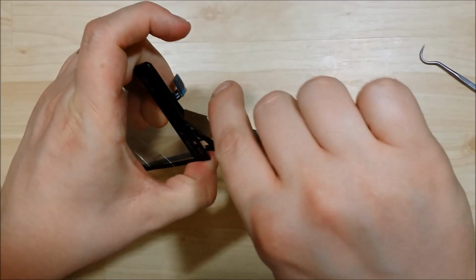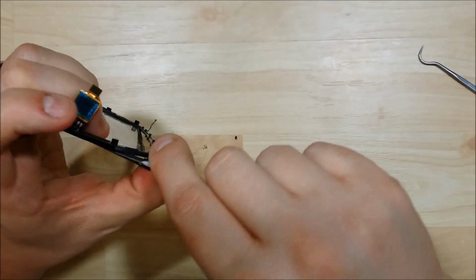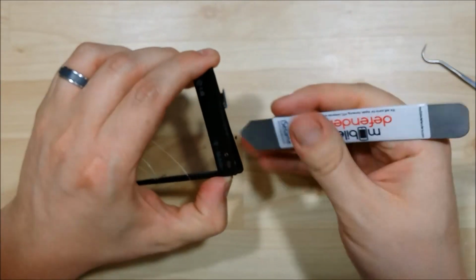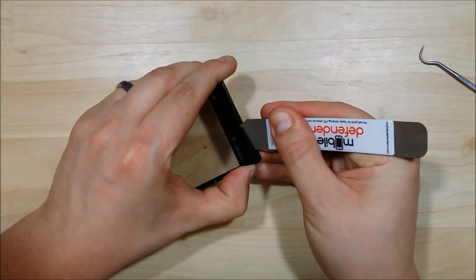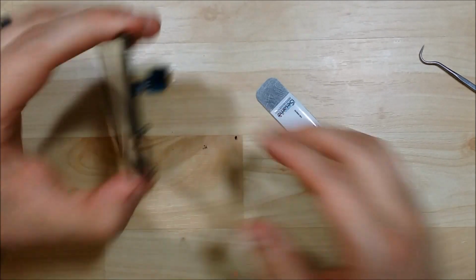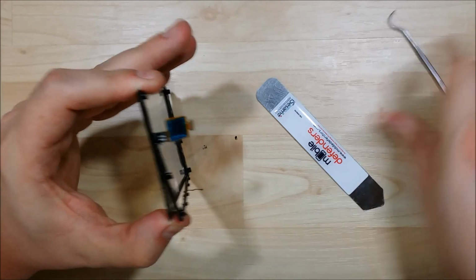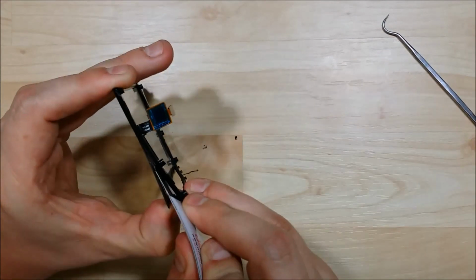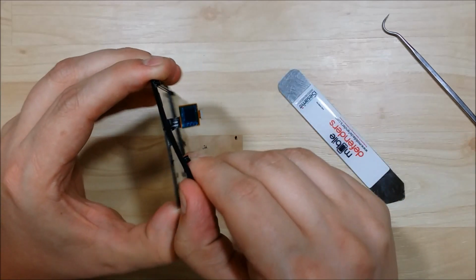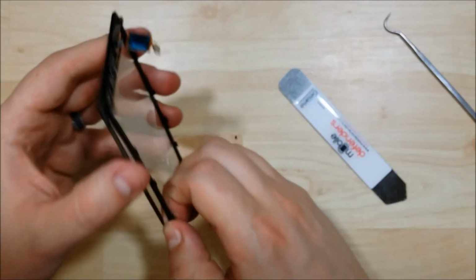There's a lot more tape on the upper side of this phone. It's very thick tape and glue. So if you're using a 3M double-sided tape, and in my reassembly you'll see me actually using 2 layers of tape to really get the length we're looking for. I'm trying to be very careful here. Try to get this glue to separate here a little bit for me. Try to cut it with my opening tool. There we go. Getting more separation. Try to be a little gentle down here.